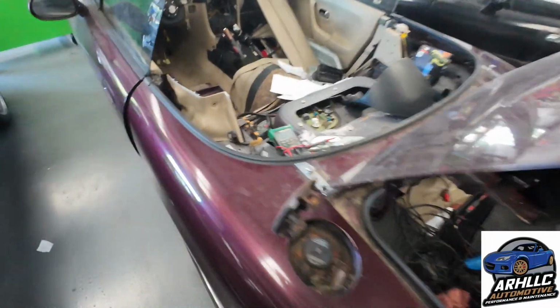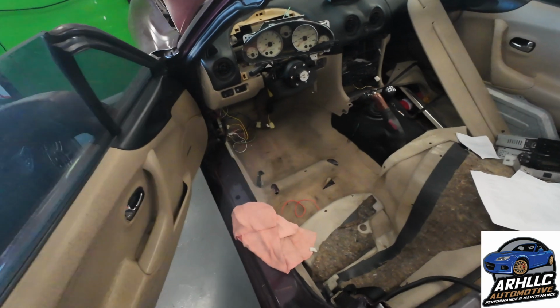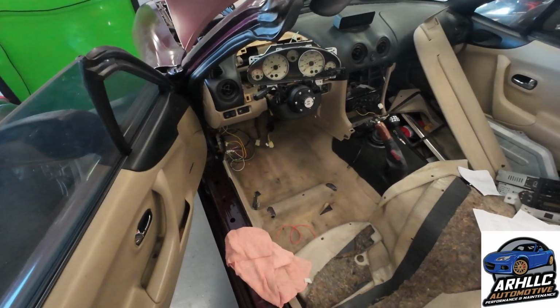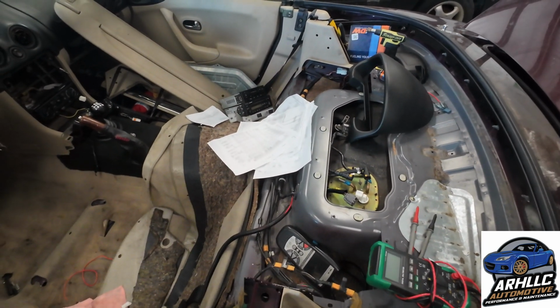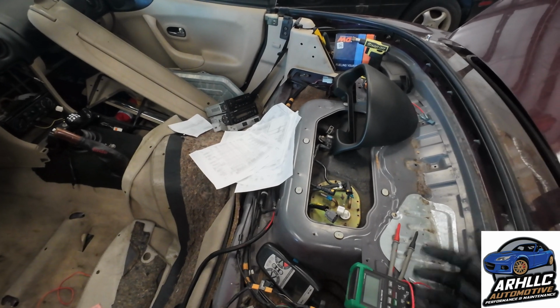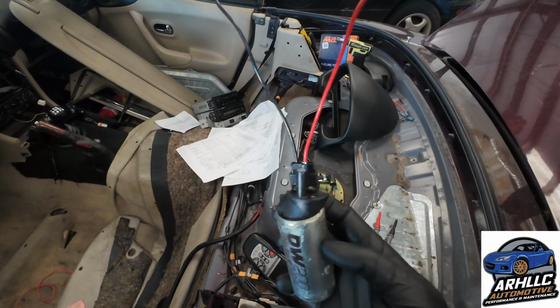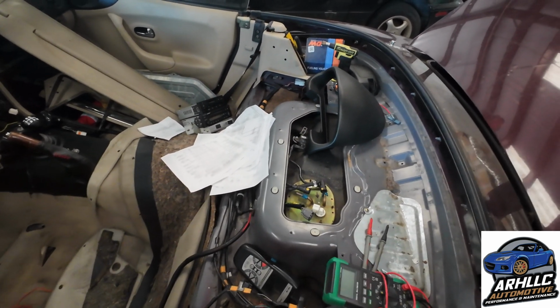We found out that their fuel tank was empty. We had an issue with the wiring up under the dash. Some of the wires are different colors than they're expected to be. So it ended up that the fuel pump was left on and we didn't hear it and it melted itself. I'll show you a picture of that. Oh, actually I have it right here. Check it out. So the fuel pump melted itself because it was inadvertently left on. We'll take care of that.